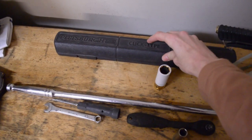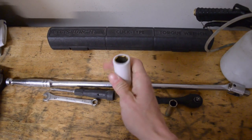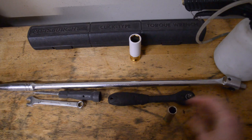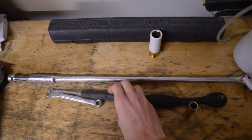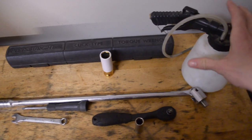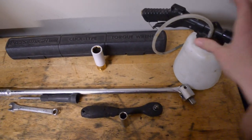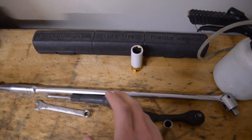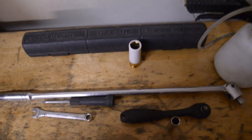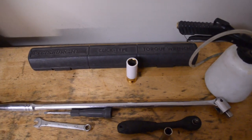For this job you're going to need a torque wrench, a 16mm socket for the wheels — this is a padded socket, I recommend it and I'll link it in the description below — a 13mm socket, a socket wrench, a breaker bar, a flathead screwdriver, an 11mm socket, and a brake bleeder, which is semi-optional. Either way, if you have one of these cars I recommend you pick one up. You're also going to need the brake pads — I'll link the brake pads for both steel brakes and carbon ceramics in the description, and I'll make recommendations for the steel brakes as well since you have a couple of options.